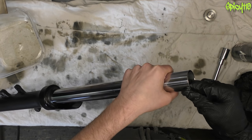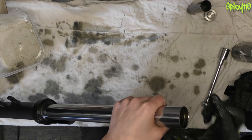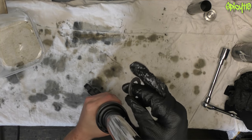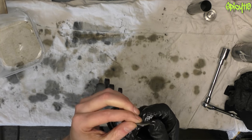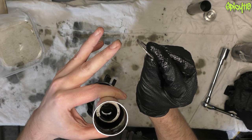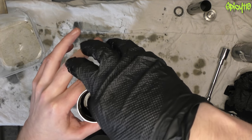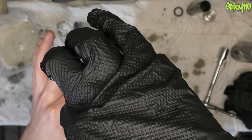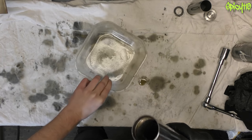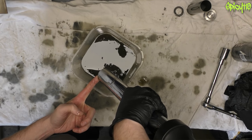Top cap off, and we need to get the tube out. The next thing down there is a washer — at this point we can compress the fork down and take the washer out. On some washers there's a rounded side and a sharp side; I return things the way they were, so sharp side down for the top washer. Then there's the spring. Now you can take the spring out now, but if you do — oil goes everywhere. Best thing to do is drain the oil before you take the spring out.